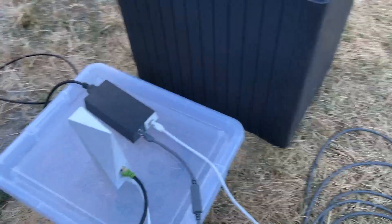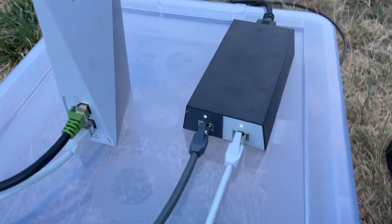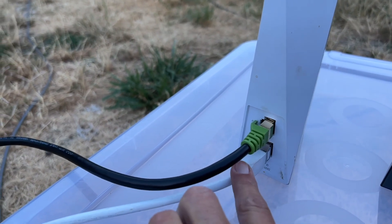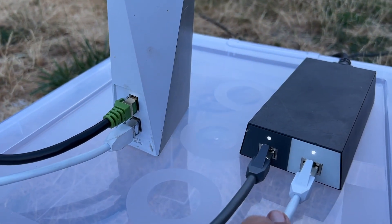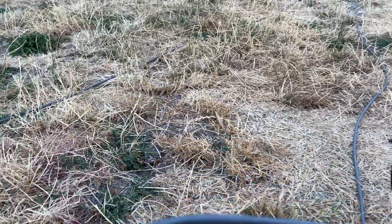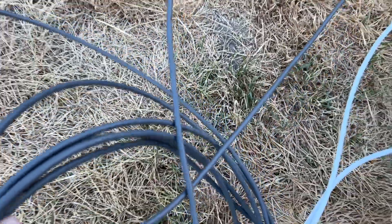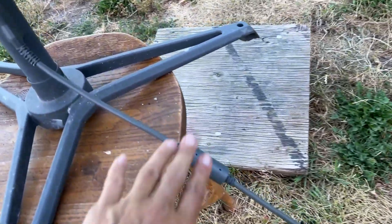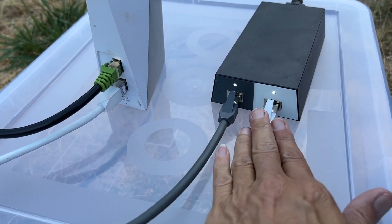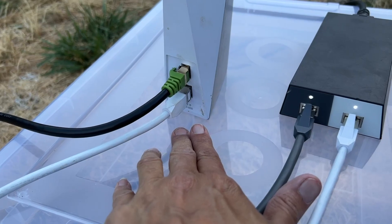Around the back of the power unit, we have two ports. This white port goes to the router — it's this one here. So that one and this one are the same cord. This cord is the Starlink cord that is really long and it goes here and comes up. The gray cord that comes from your Starlink satellite dish is the one that goes into your power unit. The white one is the one that goes into your router on the bottom plug.